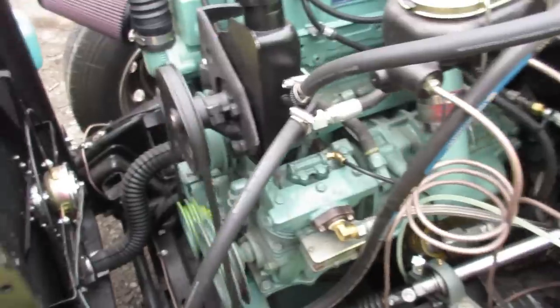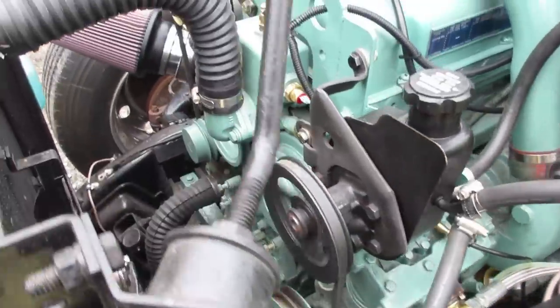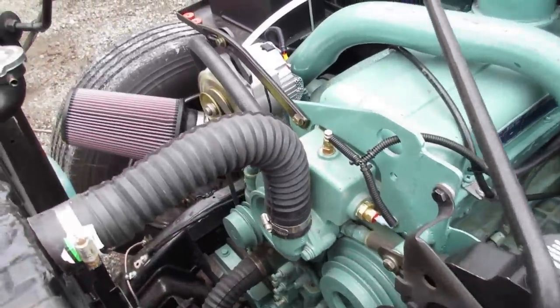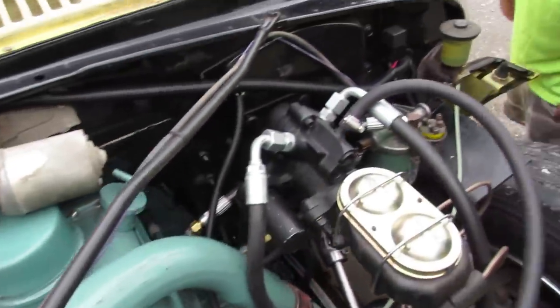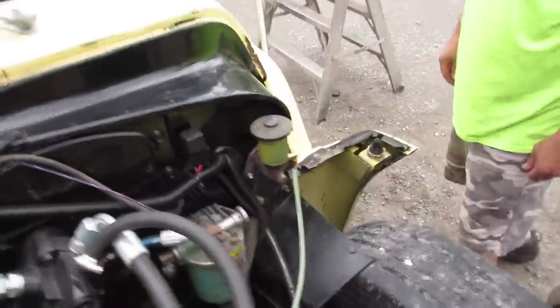Picked up a deal on eBay for $225 and got it home, had to change the pinion, and the starter guy was really nervous about taking it because no one does air starters anymore, no one has the manuals. He changed the pinion out. When I went to pick it up, he goes, oh, you know the starter's turning the wrong way. How are you mounting it? I said, like a Chevy V8. He goes, oh, it's not going the right way. And he had a hard time tracking down the information on what it needed to be flipped.